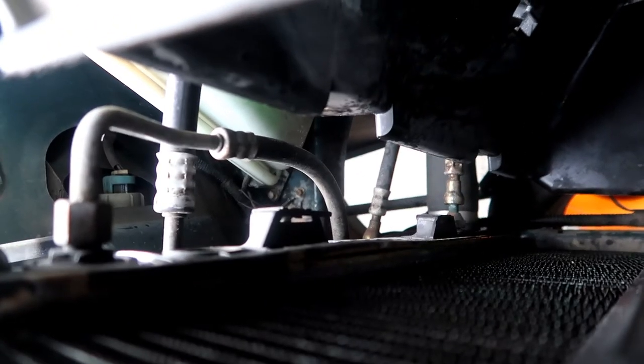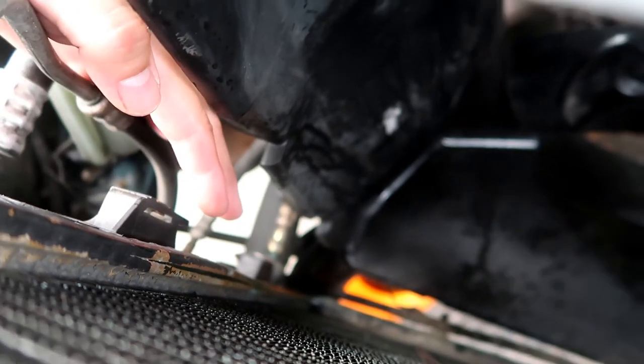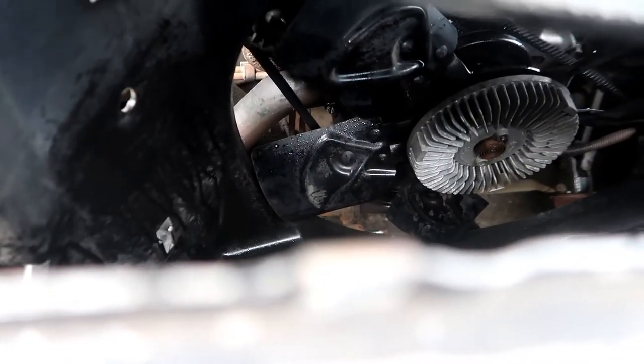About a day later I see a split in the radiator and I'm dropping coolant. It started off about an inch and was identified during an inspection — he said it'd probably be okay for a little bit. Well, within a day it's grown. You can see that split right there in the center; it's still hot but that split is probably about four inches now and it's spraying coolant under the fan.